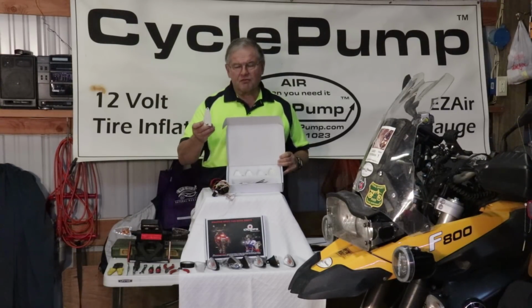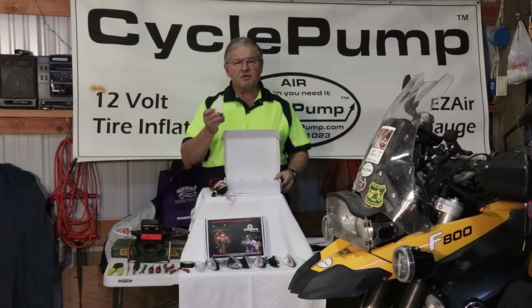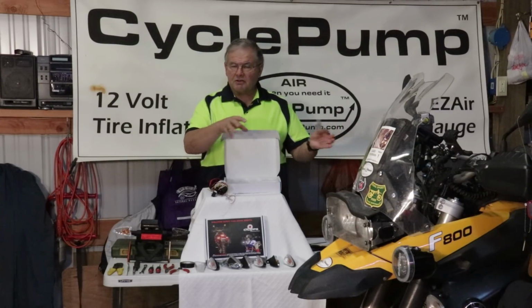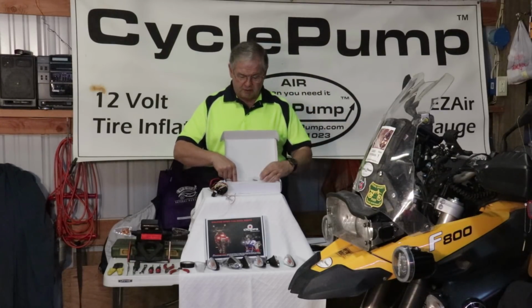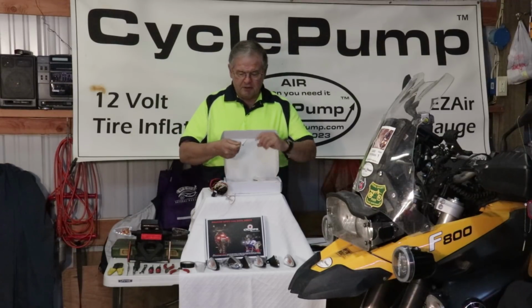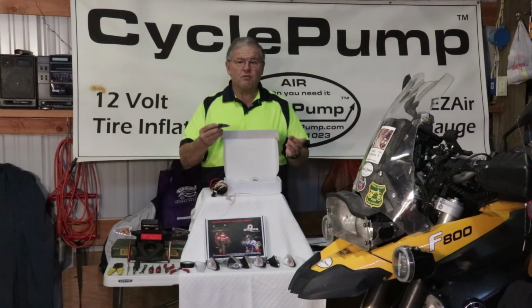But what I'm going to be doing is removing the internal components of the signal assembly, replacing it with this board, running a wire into it, and then running the electrical system into the bike. That's the front, which would have a white running light or a yellow turn signal. There's another one that goes in the rear, and this is red only, and these convert those turn signals into brake lights. We wouldn't want to mix these up.